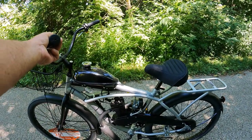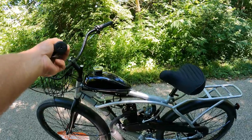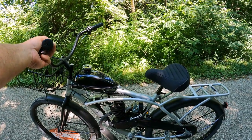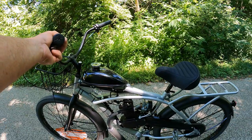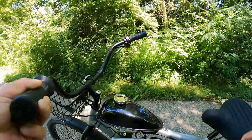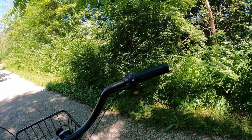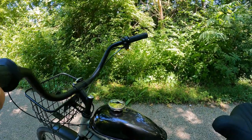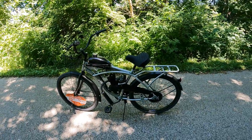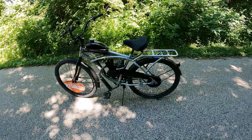Mission accomplished — it's running good. Don't worry if you hear any little rattles in the very beginning. It takes about a full tank of fuel of casual riding to get all the parts broken in. It usually smooths out, and the motor picks up a little horsepower as the rings seat with the cylinder, and you're off and riding. I'll push my kill button on my throttle. After a little break-in time, you're good to go.